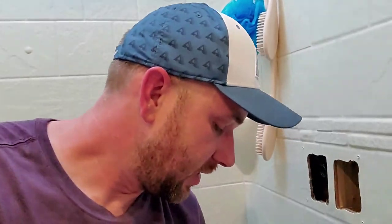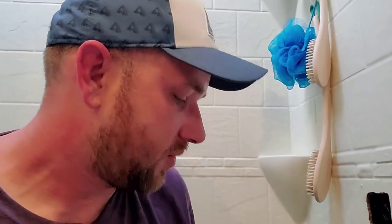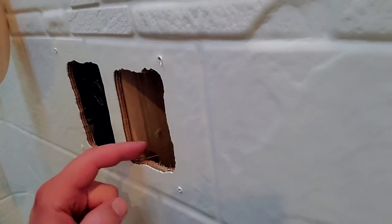The smell of alcohol in a hot, humid RV — my goodness. I used my plastic putty knife scraper and carefully went around and got all the silicone off. Then I used alcohol on a rag and cleaned all the rest of the residue and the last little bits of silicone. It's really important to get all that off — it's about to take my breath away. It's really important to get all that old silicone off because if we don't, the sealant I put around it in a moment won't stick, won't seal. It's just a thin shower liner to the wall panel like in the rest of the RV, so if water manages to get back there it's going to be a mess. Try to be really thorough about that.